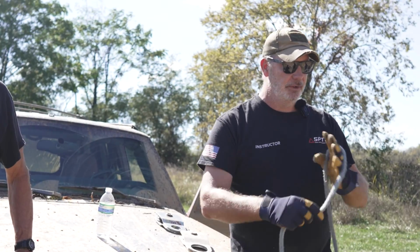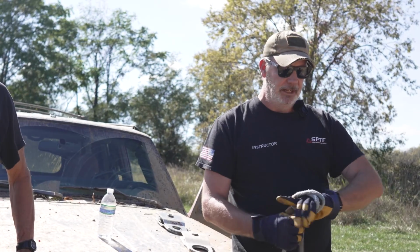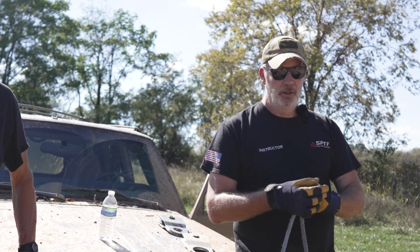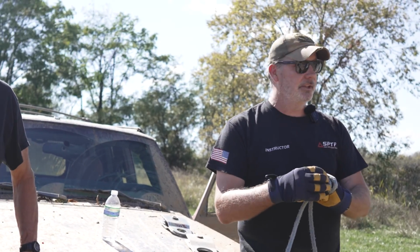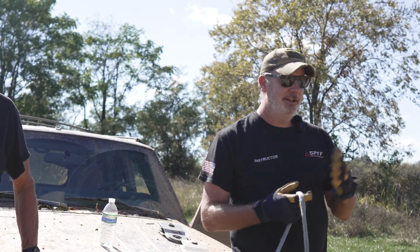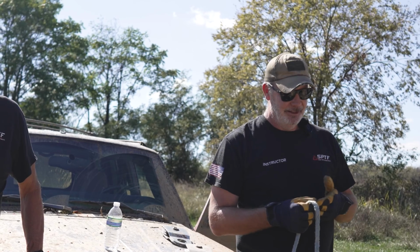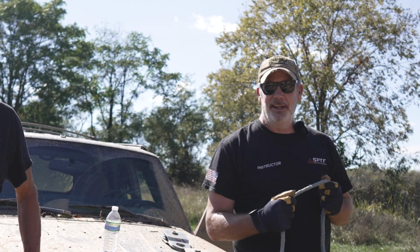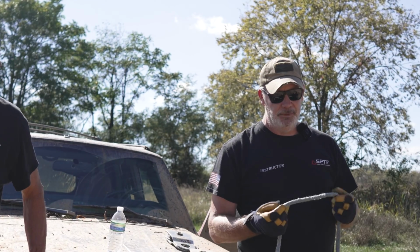So what happens to steel cable when you wrap it over itself and you put a big kink in it, or it gets compromised pretty easy? Or what happens when you abrade one of those little metal lines? You start to winch that stuff in, where's it gonna go? Into your finger, and it's gonna hurt like hell. So even if you're wearing gloves, it's gonna go right through a leather glove. So way easier to handle, it's stronger, it's safer.